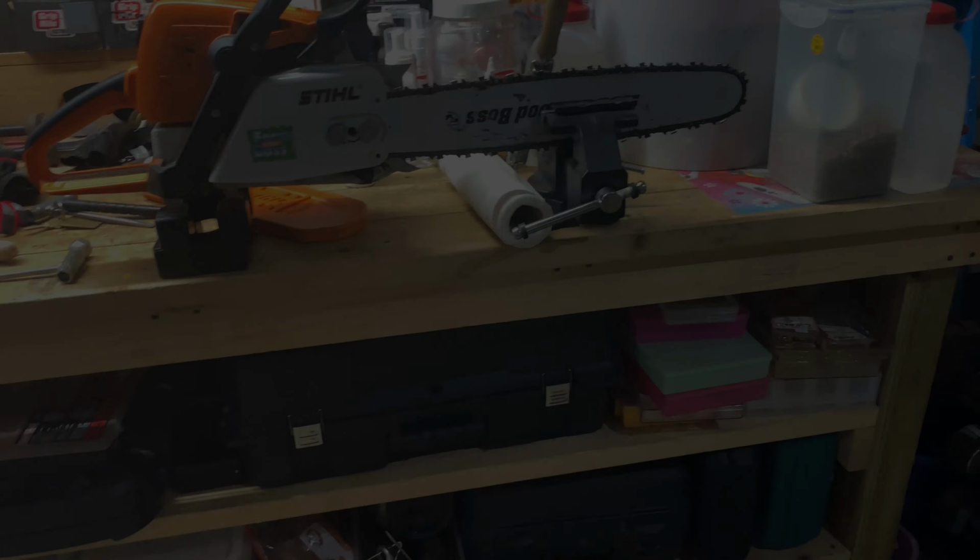When you sharpen, it's best to put it in a vise for more support. When it's held this way, you want to sharpen the teeth facing this way. And when you're done sharpening, all the teeth have to be facing this way. You'll be sharpening at a 30 degree angle. If you do it the wrong way, you'll notice because it feels pretty weird. I usually mark where I'm going to start sharpening first so I don't accidentally keep resharpening the same tooth.